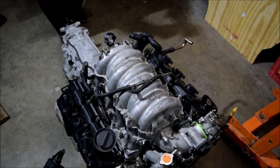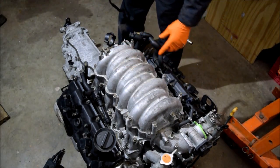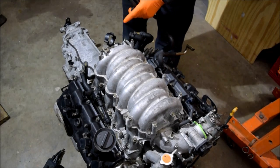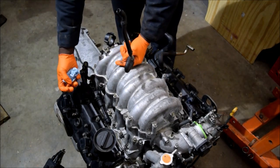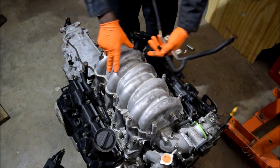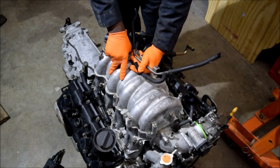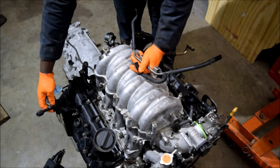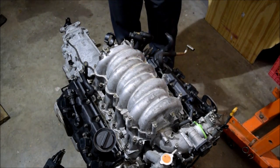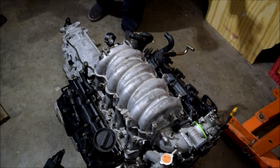Let me remove this fully. I've got coil packs off to the side — these coil packs that I have not installed are the ones that would usually get impacted by the hooks as I lift the engine. When I used to use belt straps it wasn't a problem, but with hooks as large as they are you're bound to hit something and break something, and I do have a few of those as evidence of what could happen.